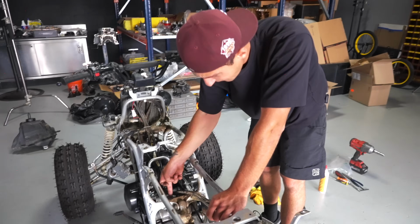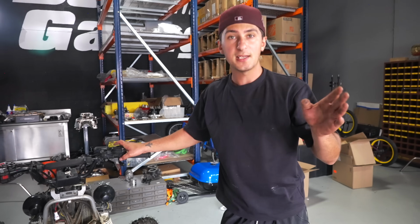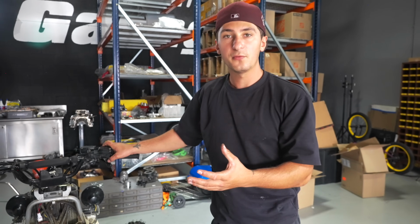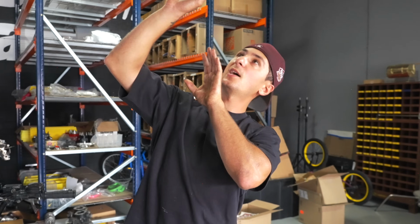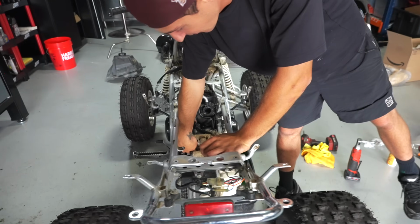If you don't, and you have this oil overflow line just running down like the carb lines do, in which I just won a Banshee from someone and that's how it was set up. Let's say you're wheeling in the Banshee, right? You're just gonna be running all your transmission fluid out. It's gonna be dripping all over the ground, and then you'll have no transmission fluid, because think about it, your bike's 12 o'clock, the engine's all the way back, all the fluid's going that way, and that overflow is right here at the back of it.